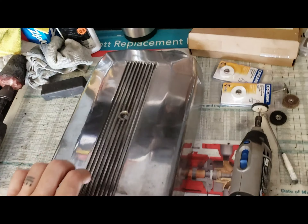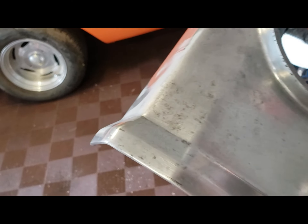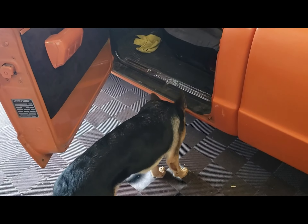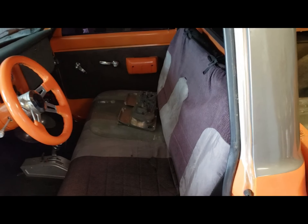Here's the B&M air filter guys - this is actually pretty cool. I've looked on eBay to try to find one of these, and they're pretty rare. You can't really find them, and if you do find them you see them used for about $380. I'm gonna clean this up and we're gonna keep it. We're gonna keep the 350 - I've already done a compression test on it and it checked out really well. So instead of doing a conventional LS swap, we're just gonna keep it old school, keep the 350 in it and build this thing up. I've already got some Vortec heads for it, so you can look forward to that in a future video.